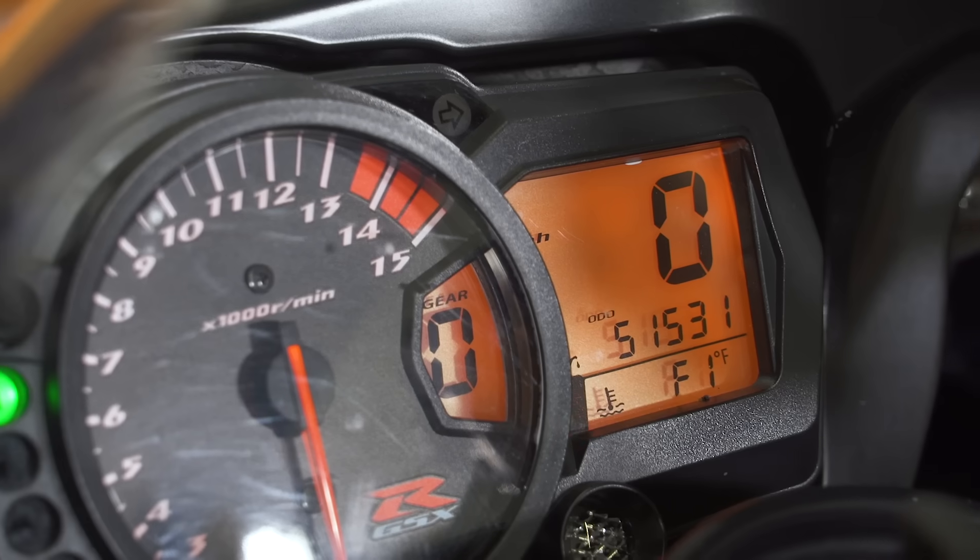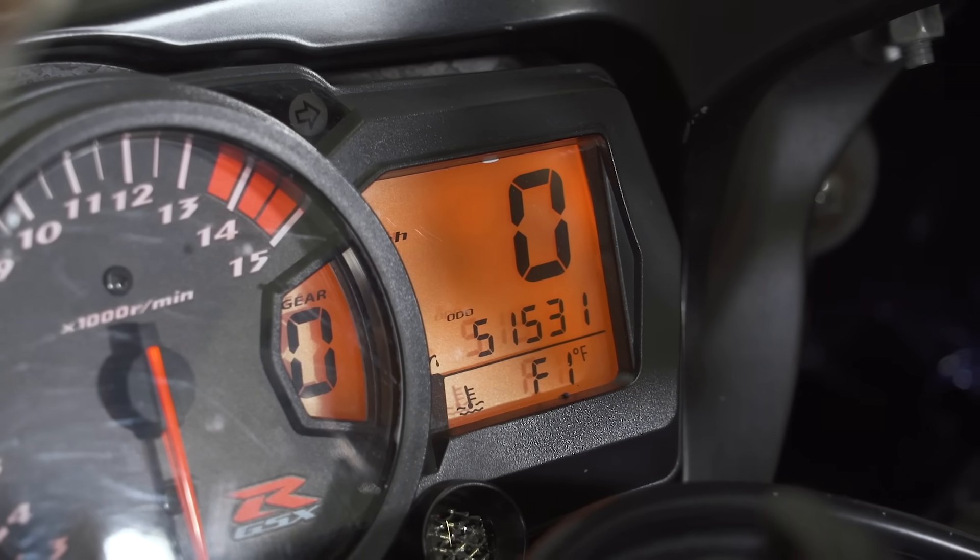In our last MC Garage, we covered step one on getting your bike back on the road: a new battery. A link to that video is down in the description. Now the bike turns over and you've got an FI light blinking on your dash. It was all good before the bike was parked, so you can safely surmise your issues come from bad fuel. Fuel can go bad quickly, even in a matter of weeks. But in our case, two years has not been kind to the small amount of fuel in our tank. Volatile components evaporate, and then the gasoline contains a gummy residue of stuff that doesn't evaporate. Even worse, if your gas contains ethanol, it could attract moisture, which then leads to corrosion in the steel tank or metal parts in the fuel pump and injectors.